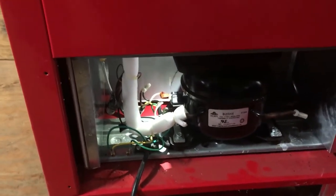At the back of the mini refrigerator you're going to find the compressor. Close to the compressor — this one's right on the side, most of them are on the side — you're going to have a little run capacitor and start relay, and you have some wires going into it. Just note how they go in.